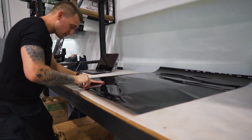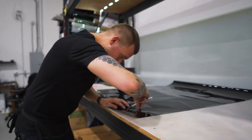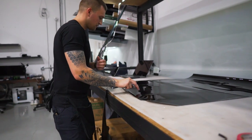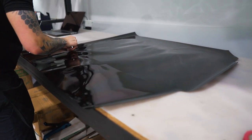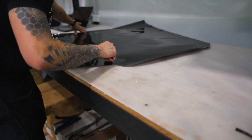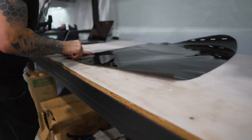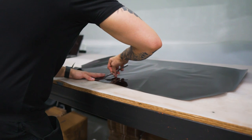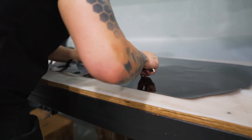Now if you're using a pre-cut, or even hand-shrinking or hand-cutting, you want to make sure when you cut it — before you shrink it — it's as tight as possible. Unless you're pull-shrinking, that's another story. If you're doing a pre-cut, make sure the excess material around the edge is very close, because on the bottom, it's kind of like shrinking a beetle back window — it gets very tight and tends to overheat quickly because it's so much material you're trying to shrink. I'm practically cutting it on the line for the pre-cut, because if you have extra clear, that tends to burn before the tint does and causes more problems.